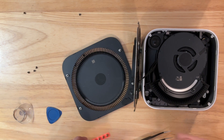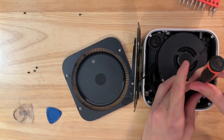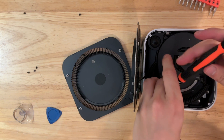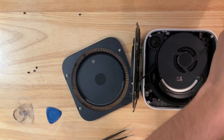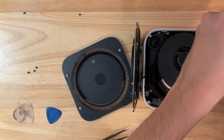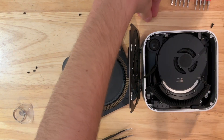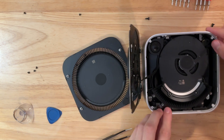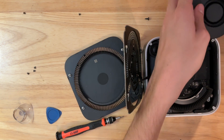Battery's back in and we got this opened up. Now it looks like we're going to need a T3 screwdriver to get the fan out. I'm going to put this screw right here and this one right here. We're going to use the T3 again to get this off — actually we need to go bigger. I think this is the T5. And there's one hidden screw right here — that's the biggest screw inside of here. Then we get to reposition the fan. And we can now see the SSD in there.